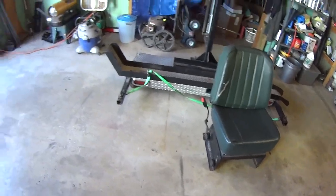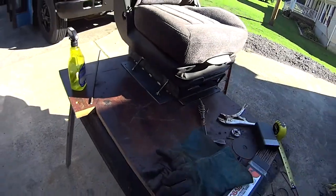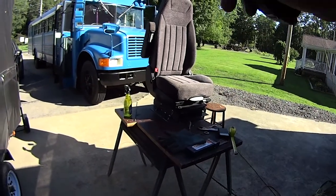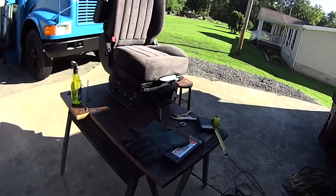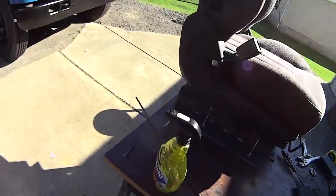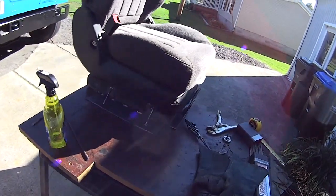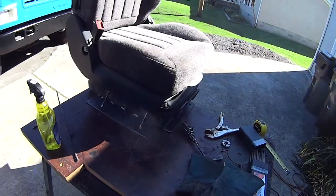So what I did is, a local welding shop — I just had them cut me a piece of quarter-inch steel plate, which is right here. I sat that seat onto the metal plate, marked the holes, then took it in the bus and put the bolts in to make sure the holes were lined up with the floor. Then I welded the plate to the underside of the seat. It had a flange on the front and the back, but I cut the back one off because I wanted the seat to come back as far as I could, since the sliding position to make it go forward goes up really far. I welded it on either side — just some spot welds — then put these strut rods in and welded them in there just to beef it up.